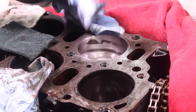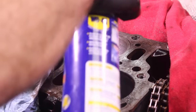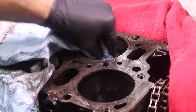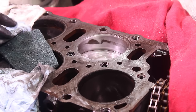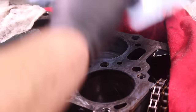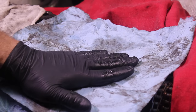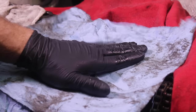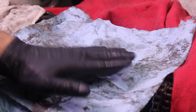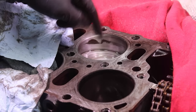I think that's going to do a really great job for our engine refresh. When you're done with each one, go ahead and give it a little spray — pat the WD-40 down on the cylinder wall and on the piston. That's going to keep any moisture or water from getting in it. What I like to do also is after I finish, I'm going to take some of these shop towels, set them over the top, and spray a little bit of WD-40 on the towels to help even further prevent any evaporation and moisture from getting in. Remember, WD-40 stands for water displacement, so this works really well in this application because it may be a little while before we put the head on, and we want to do everything we can to help protect the cylinder walls as well as the pistons.